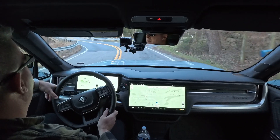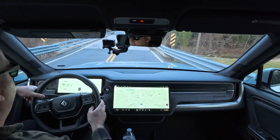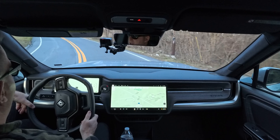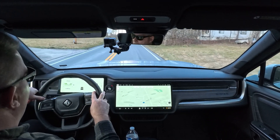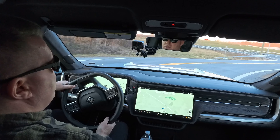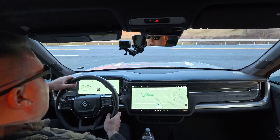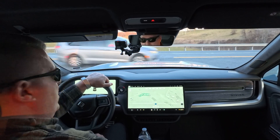One of the main things that's going to affect your efficiency in your EV is your tire pressure. As a general rule, you want to check your tire pressure first thing in the morning after the vehicle's been sitting all night. You're going to look in the driver's side door jamb, and in there you'll see the manufacturer's recommended tire pressure. For the Rivian, it's kind of high — it's 48 PSI. I think Teslas are 42 PSI. Having your vehicle inflated to the proper tire pressure is going to ensure that you're not losing efficiency, and the vehicle will actually handle better as well.